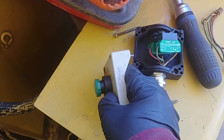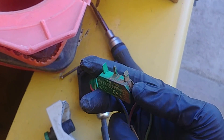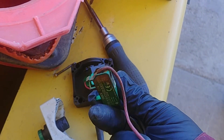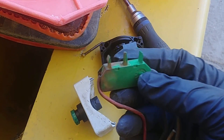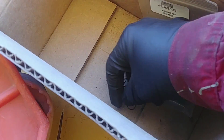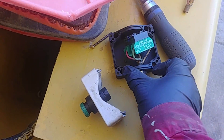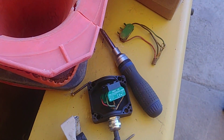There are two ways to engage the feed roller — you can read it from the manual, with a bar or with the hold-on reset switch. What was wrong with that switch: water had been getting in over time, and the connections and the switch itself had completely rusted out and corroded.